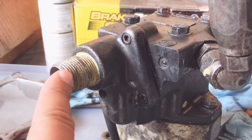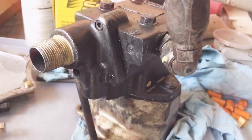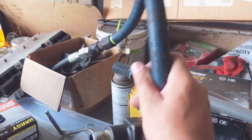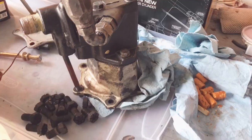This is the intake where the oil goes in from the reservoir. This is the tube that it goes to my power steering system at the front of the bus. I put a drill onto this end — you can see that nut in there — and I spun it both directions to see which direction it was actually pumping the fluid. And right now it's set up to go counterclockwise, and it pumps the fluid.